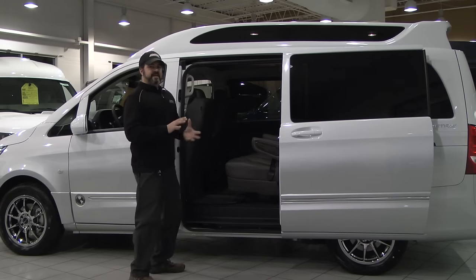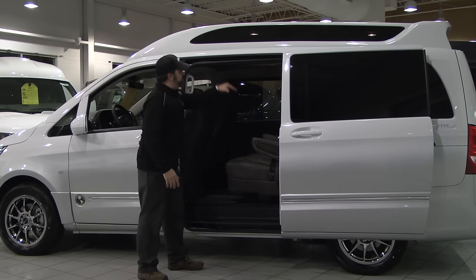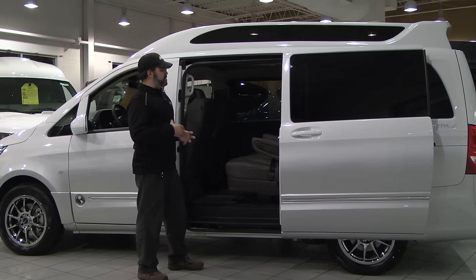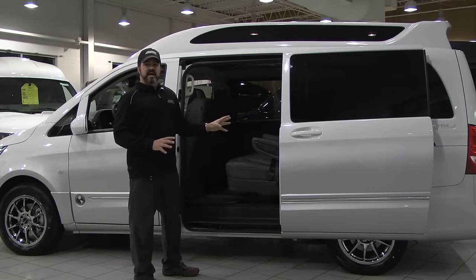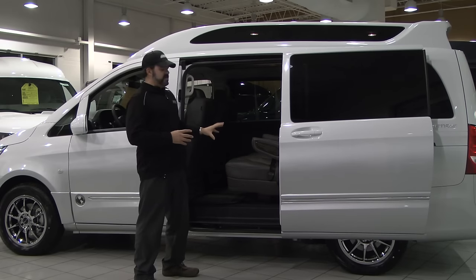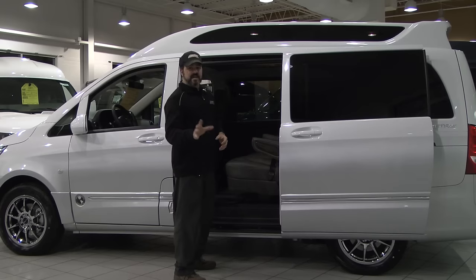As far as overall height, the sill here on the floor is 19 inches off the floor — that's a nine-inch reduction from what they have in full-size GM vans, where you wind up at 28 inches versus this 19. Having that 19 inches is going to open up a couple of things — getting people inside and out makes it much, much easier. As far as the doors and mobility concerns, which we haven't gotten all the way into yet because they are so new — the height in the door has not changed from the full-size van. You actually have a 48-inch opening, which means as far as lifts are concerned, you'll still be able to have that full 43-inch platform to enter and exit. Currently, to the best of my knowledge, the only lift that would work in this would be a Fiorella F500, which is pricey and very limited in the market, but it is an option.